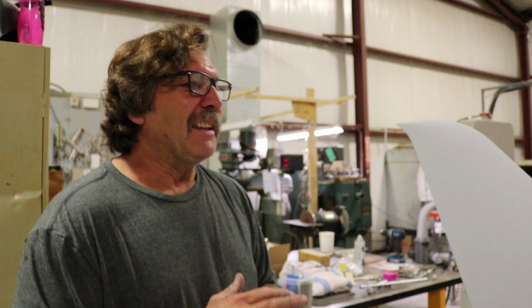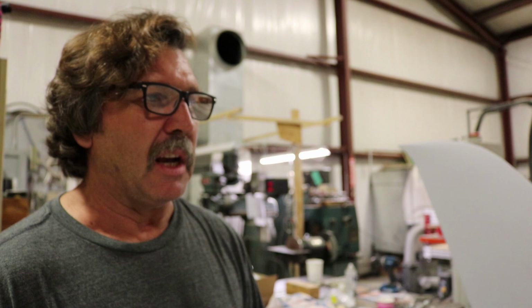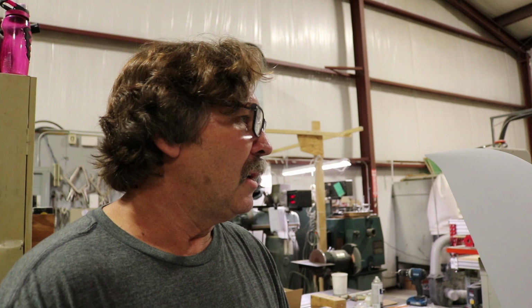This is going to be tailored around initially, obviously, the PBS Velka Bites engine out of Czechoslovakia, the TJ100. But we've got a new entry into the field in the form of the AMT Lynx, which you'll see the mock-up engine mounted in the back of here. And that's an engine out of the Netherlands that puts out a little over 100 more pounds of thrust in the same basic sized and weight package. So that's the idea behind the class.